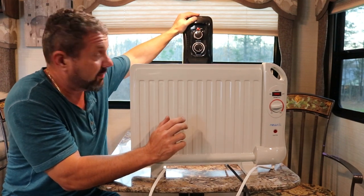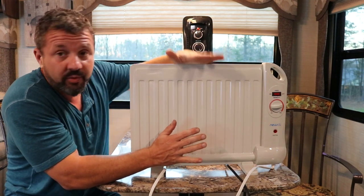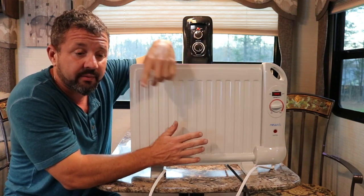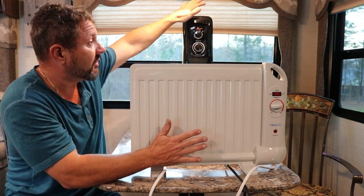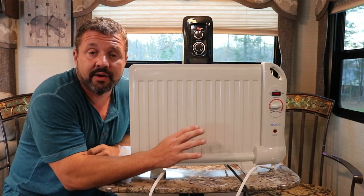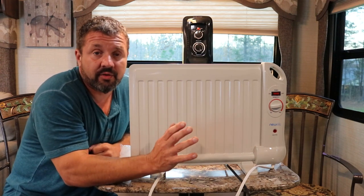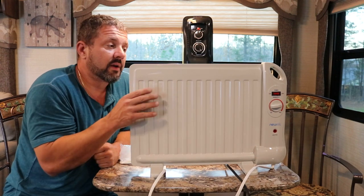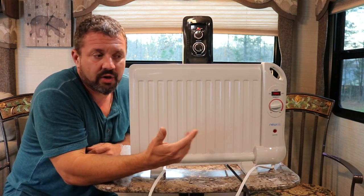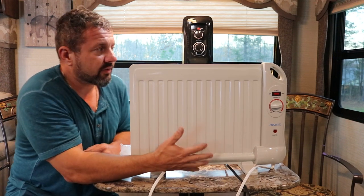This one in one steady place is big and honking. This takes 1500 watts; this takes 400 watts. I'd rather distribute my heat and supplement it with the furnace than run 3000 watts, because that's going to drag your power down big time — it costs you a lot in power. Now if you don't pay for power and you're in an RV park, that's one thing. But if you're a full-timer or even camping in the winter and you only have a 30-amp coach, you're only pulling 800 watts with two of these. It's not as bad — you're not dragging the power.